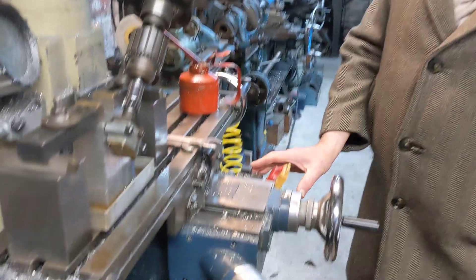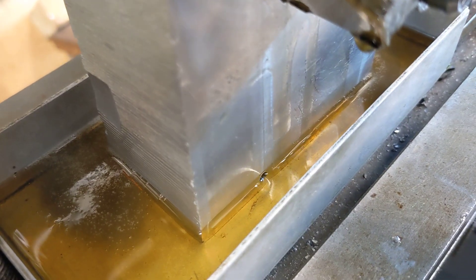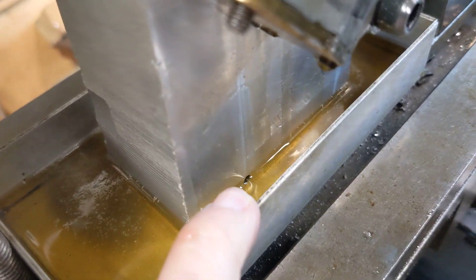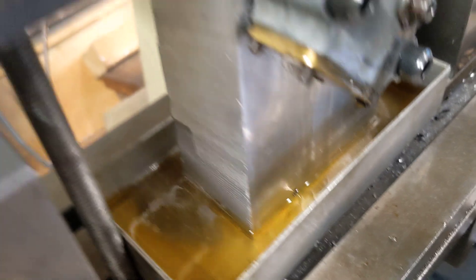If I just get my glamorous assistant here to turn it on — do you mind just pressing the button for us? You can see at the bottom there, that is the scavenge hole, and you can see the pump just drawing up the oil as we turn it on. It's also reducing the level, with a tiny bit of air being ingested like it would do when it finishes the scavenge.